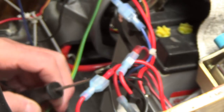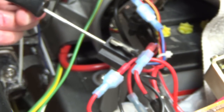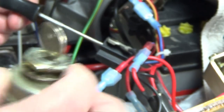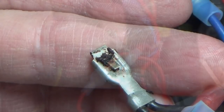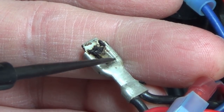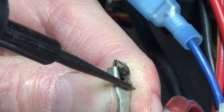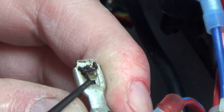What I'm doing is I'm taking my plug here that will go into the back of my ignition switch and I'm rearranging the wires so they match up with the ignition switch. If you look real carefully, you'll notice that right here on this plug it has this little raised portion, and all that does is it catches on a little nub on the inside of the switch. I'm going to bend it back just a little bit so it'll get a good positive connection when it goes back in.